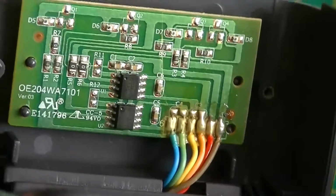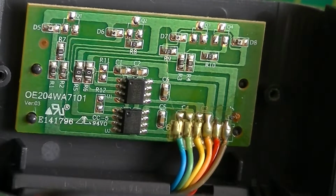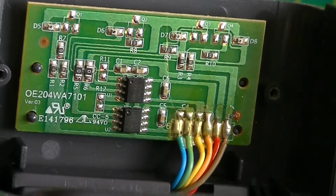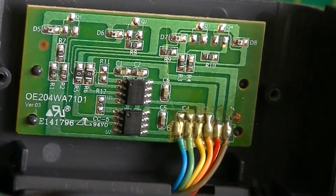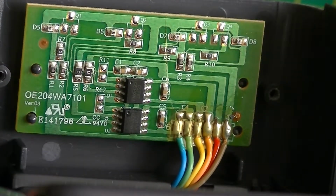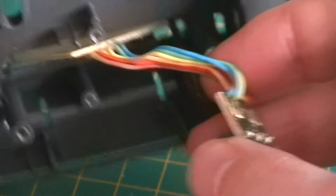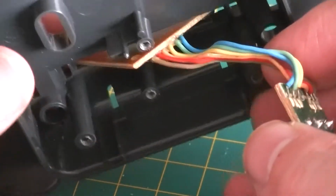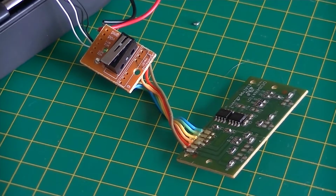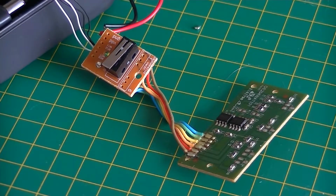Which reveals the rather spartan main control board, the main feature of which are these two small chips marked CST117. A little investigation shows these are 8-bit CMOS microcontrollers. And now we can remove the front plate and feed that main control board down through the slot. And so this is all the poor little Yobot has to show as far as grey matter is concerned,